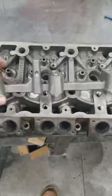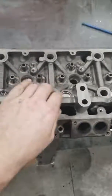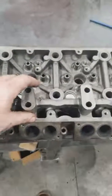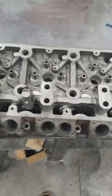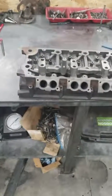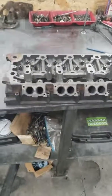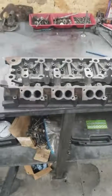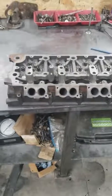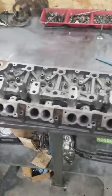Anyway, just wanted to show you. So if anybody has run across this problem here as of late, please let me know. Like I say, in 2015 they did have this issue — they just said the pedestal was machined incorrectly and it was exhibiting problems of low compression, no-start issues and things like that. So that's something to be looking out for, especially if you're a shop owner or a tech. Keep a heads up for that, examine the pedestal before you install it. Thanks for watching.